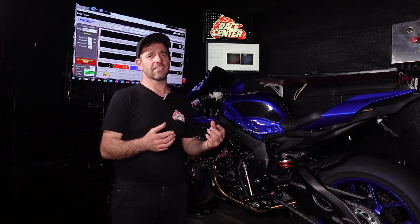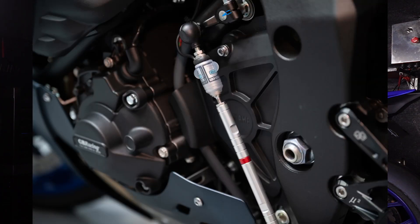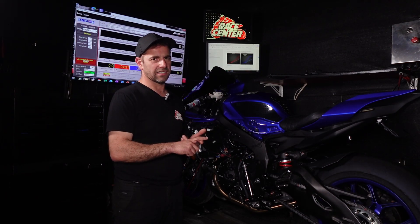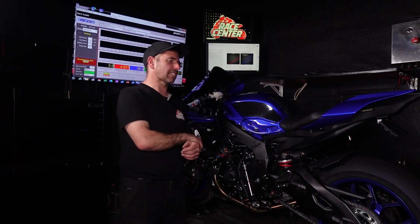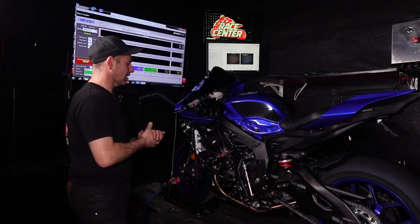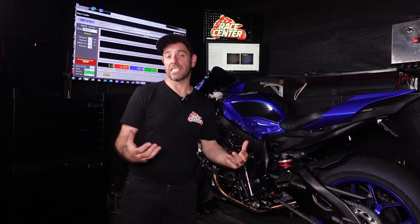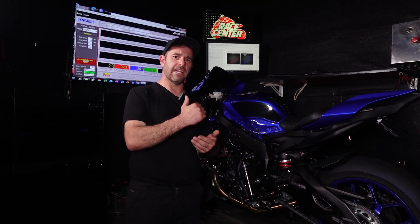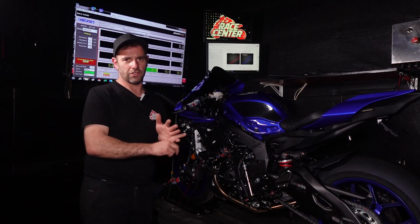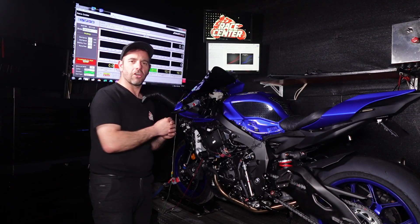This bike has a Translogic quickshifter and blipper working fantastically well — it's had the suspension done, the NJ84 throttle maps, a custom tune, and a full exhaust, so it's got everything. In terms of priority order for these R1s: first, the throttle maps — they need to be addressed, they're not good out of the box, and you won't know yourself once you've changed over to the NJ84 maps. Second is the suspension. If you're budget-conscious, throttle maps first, suspension second, then a full exhaust system and tune. That order is what's going to get you the performance. It came up great, sounds amazing — probably time to go have a listen to it.